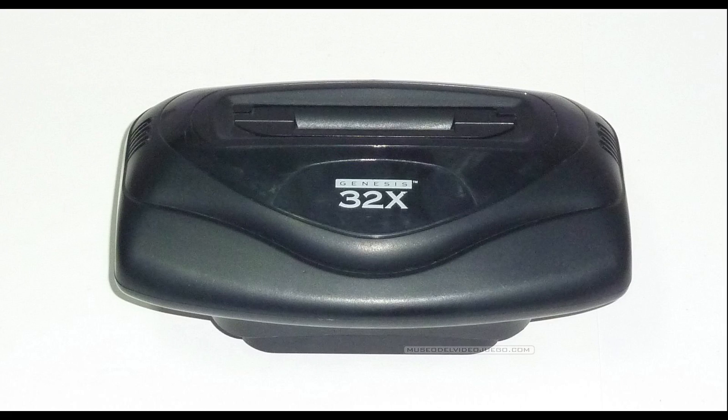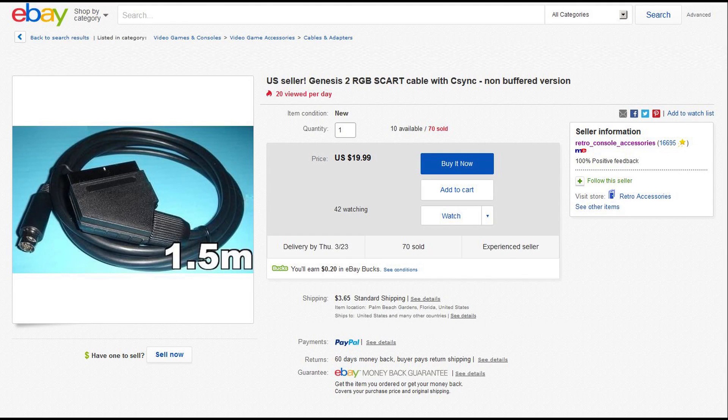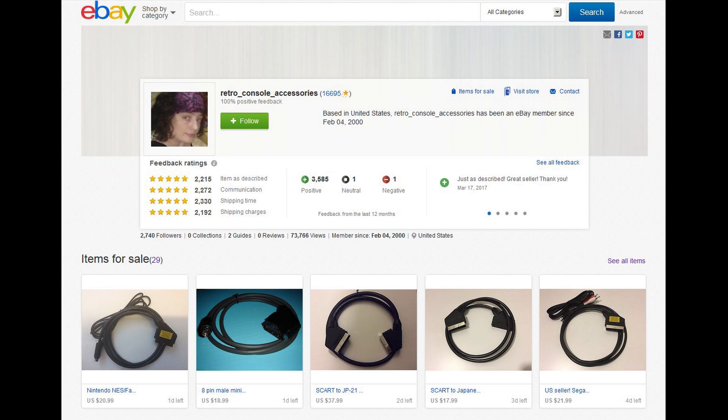Unless you've imported a SCART compatible television — kudos for that kind of dedication. The port itself is not an RGB SCART standard port because it just doesn't have the space — they didn't put a SCART port on there. Instead, they put another type of port on there, which is the same exact port that the Sega Genesis Model 2 and the Sega 32X both use. The reason that's good is if you're into RGB and retro consoles, there's a decent chance you actually have this cable already. If you don't, there's an eBay seller named Retro Console Accessories — that's where I buy all my RGB SCART cables, and it's actually the same one that Stone Age Gamer recommends. You can buy the Sega Genesis Model 2 ones and they will work with this device.